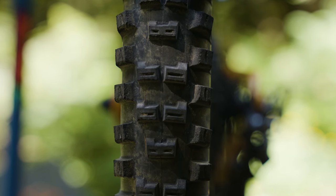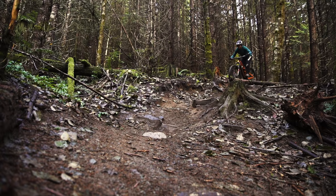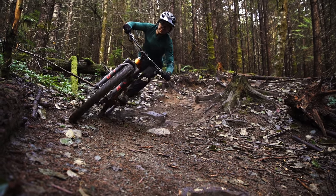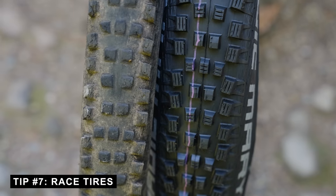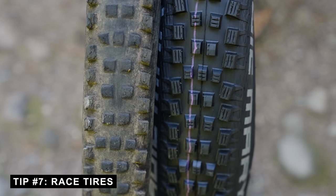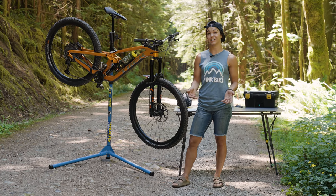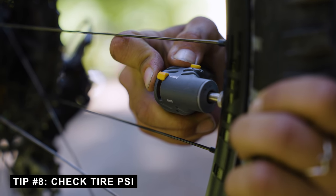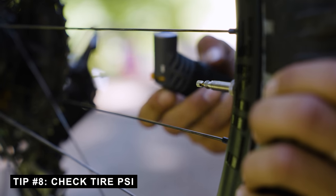When it comes to tires, really fresh grip with good tread is going to make a big difference - it gives me a ton of confidence going fast and cornering with speed. Even if you only keep one set of fresh tires through the season, throw them on for your race laps. If you put fresh tires on the night before or you're in a different location, it's not uncommon to lose a little air pressure overnight - especially with a tubeless setup - so in the morning, bring the pressure gauge out and double-check where you're at.